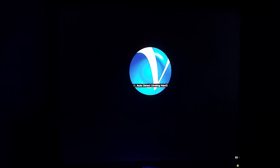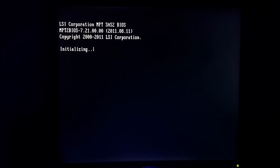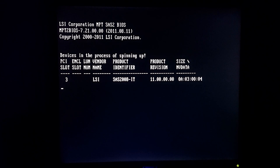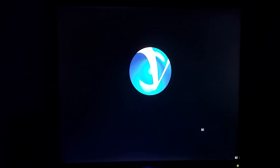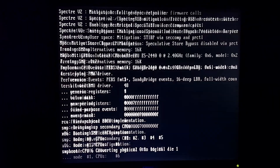This is what it looks like when we boot up the server now. Unraid will be booting off a USB pen installed internally on one of the USB headers. I bought a little adapter which adapts the USB header on the motherboard to a USB socket to install a USB pen drive — that way we don't need extra power connectors or cables and can maximise the number of disks used for storage. I could squeeze another two disks in but I'm limited by the number of power connectors available from the modular PSU. Either way, it's 3 times the storage I had on my Seagate Personal Cloud, which was 5TB.